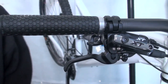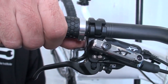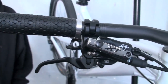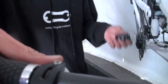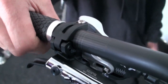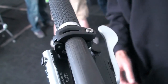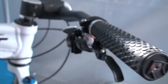The shifting system is all 10-speed, and we've added a few new features to the M780 10-speed. One is what we call multiple release — we had this on XTR last year — so I can get two shifts, which are release shifts into a faster, taller gear in the back. We also have what we call vivid index shifting, so there's a little more tactile feedback — you're not only listening for the shift, but you're feeling it through the lever, so you know exactly what you're doing on the trail. Of course, the I-Spec bracket lets you choose either an individual clamp mount or the integrated bracket where the shifter mounts directly onto the brake lever for a very clean mounting.